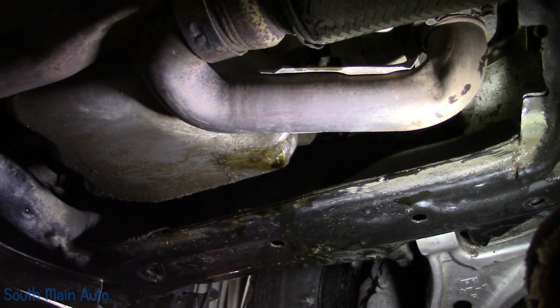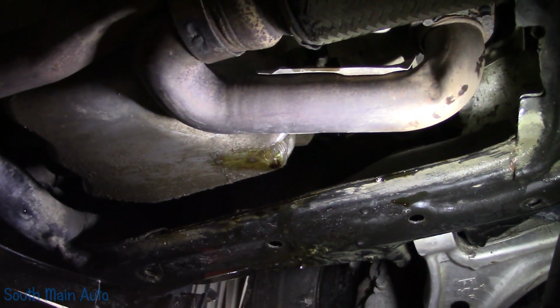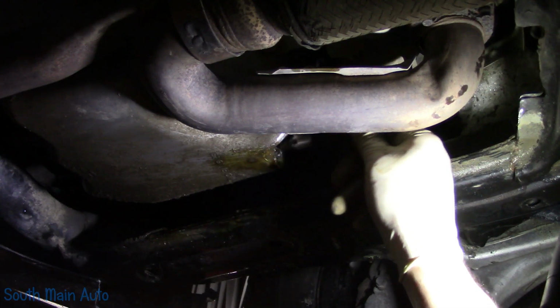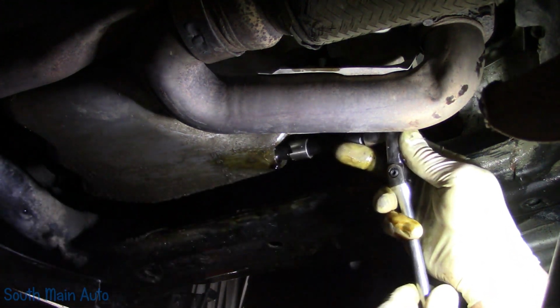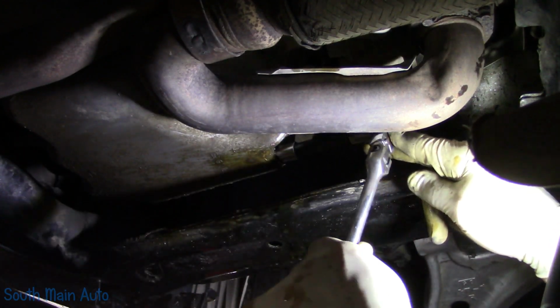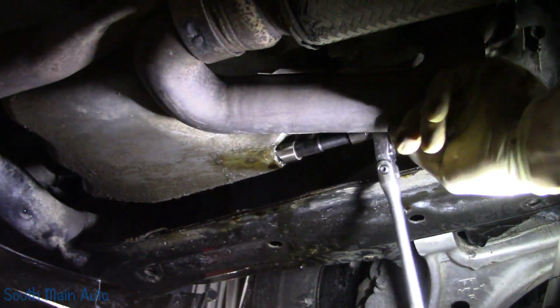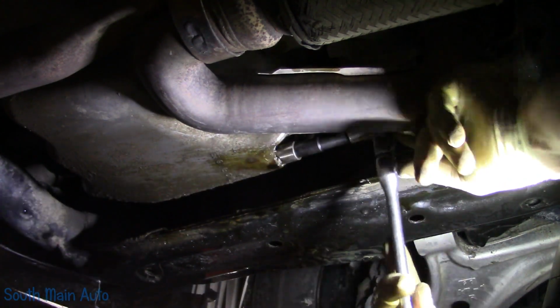Once that's done, what we need to do is counterbore it, because we're actually putting in a full steel insert. This is the counterbore bit. As you can see, it's got four teeth on it. There's a sticker right up there. It has little steps on it and it's only going to go in so far, and it'll stop on its own. You do have to take it all the way in. Switch bits here. That kind of self-pilots. Like I said, these tools are very, very sharp, so just a little bit of pressure and it should cut its way through. Maybe a little more pressure.